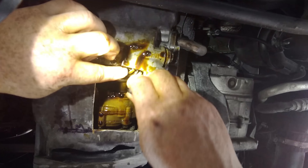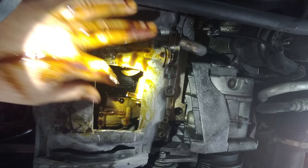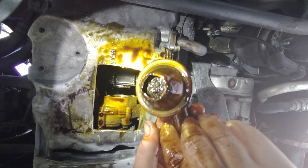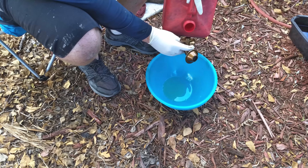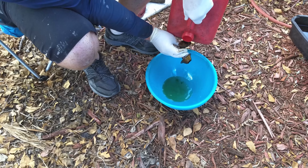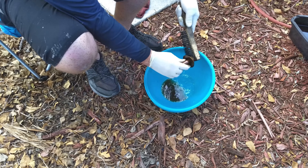The sides cut with the grinder were actually very smooth — not sharp — so I didn't have to worry about cutting my fingers, though that may not be the case for everyone. This kind of looks like open heart surgery with all the oil dripping out. Eventually I persuaded the bolt to come loose and removed the assembly. You can see there's a screen that stops debris from going back up to the engine. I took some gasoline in a bowl and swirled the pickup tube with the screen to clean it out.